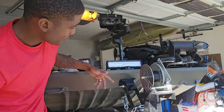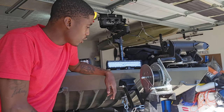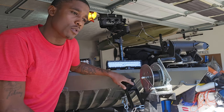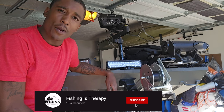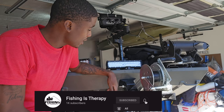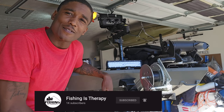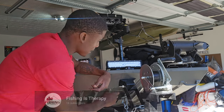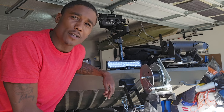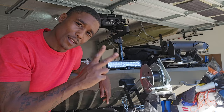This is how you install the bow stop — save yourself a lot of trouble and avoid future repairs. If you've got a flat bottom, use a bow stop, not a bow roller, unless you want to be repairing it down the road because of excessive bouncing and cracking. It could have been worse — it could have snapped off while I was driving down the freeway. Thanks for staying tuned to another episode of Fishing is Therapy — repairs is therapy too, and it's all in good faith. See you guys next episode. Peace.